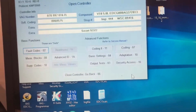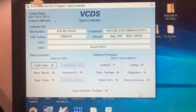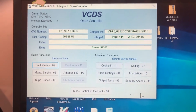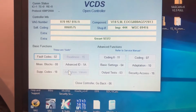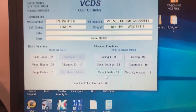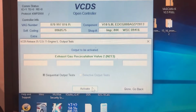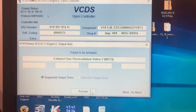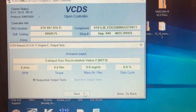So with the key on, engine off, it's not moving, it just wants to stay at 0%. As soon as you start it up, I think it does a full cycle of the turbo vanes from 0 to, I assume, 99 or 95, and I think it's going to throw the code as soon as you do that. Fairly certain. But if you know for sure, just comment below and tell me I'm an idiot and that's for sure what it does or doesn't do.